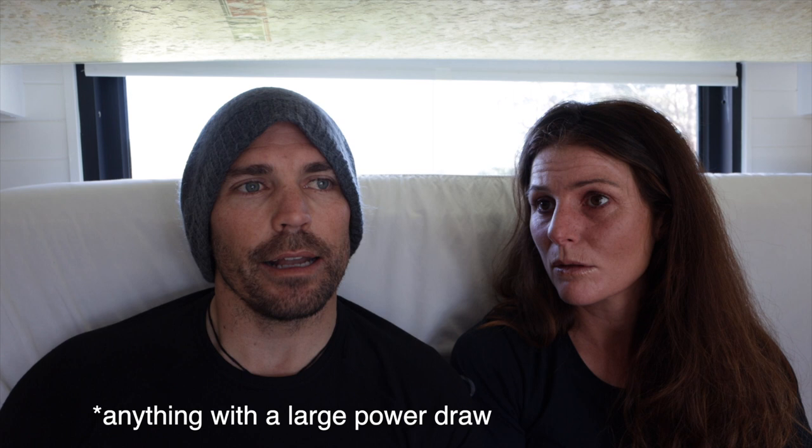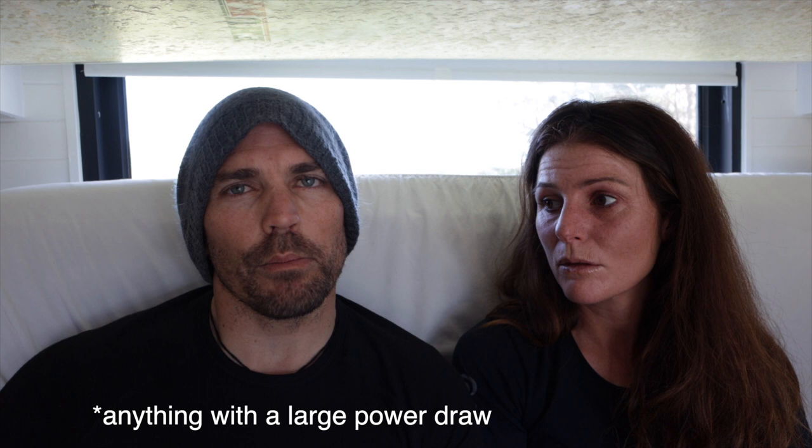One other thing we did in this last video was we just started the electricals. We got most of the wiring in. Here's just a little hot tip that we have run into. If you're going to be running a heater or something like that from your camper van, you want to have an extra socket inside your motorhome that will just run off outside power.